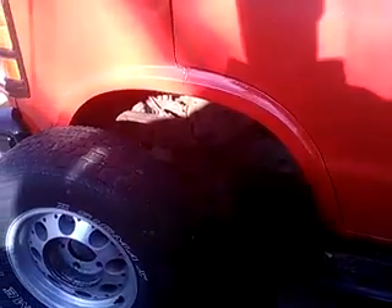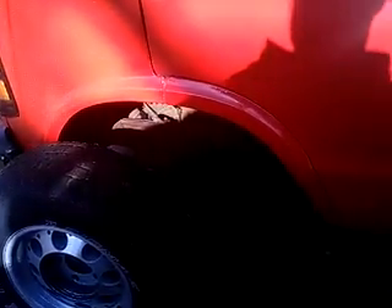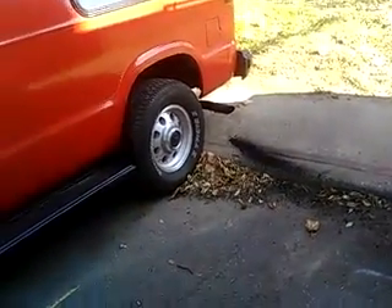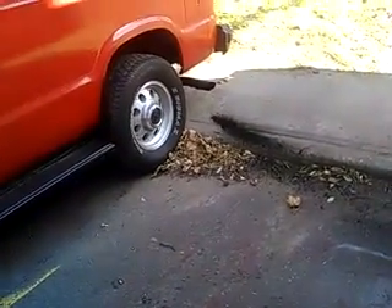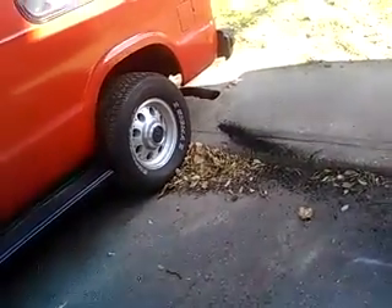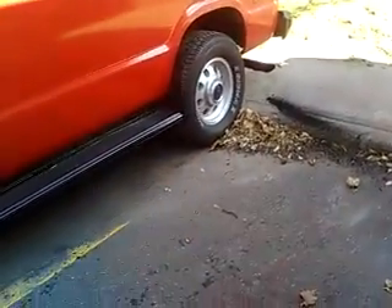This van has had a lot of shorts. It seems like every wire that I've gone up under there and redone or rewired, this thing runs better. I'm not getting the smoke that I was getting yesterday and the day before — this has been going on for about two months. And I changed the fuel pressure regulator, and that helped a lot. I got my fuel pressure up because now I can hit the accelerator and spin out of here.